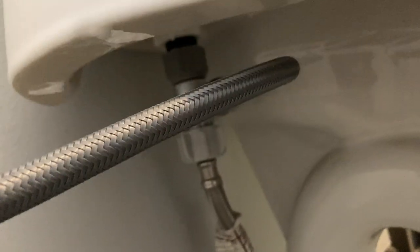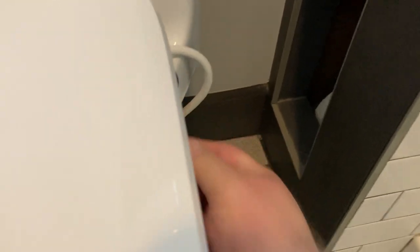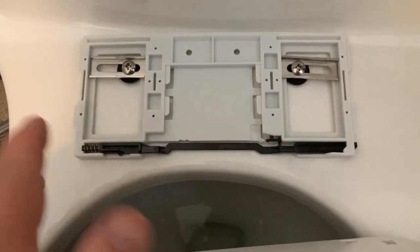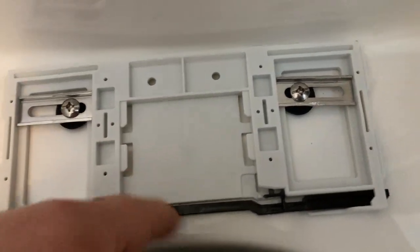The only thing I needed was a cone washer. If you look at my very first bidet video from July 8th, 2018, I'll tell you what cone washer that is. So here's the new and improved UX Pearl with remote. This is your and my first chance to look at it together. Follow the instructions — in order to uninstall, there's a little button right there. You push that and then slide this forward. They gave you a little template. The template was kind of a pain — I just don't know what to do with it. You lay it over your toilet. Here's what you need to know: this black springy thing is up, and this has an arrow pointing that way — that just means that's where the seat fits in.